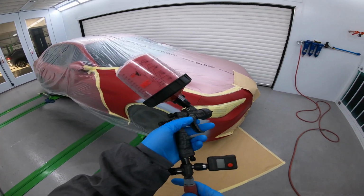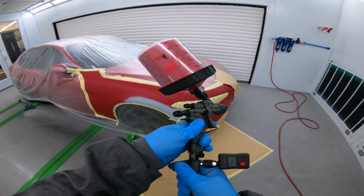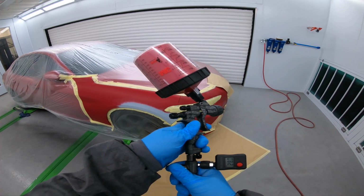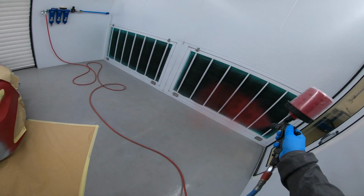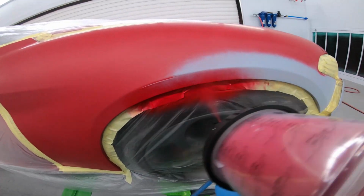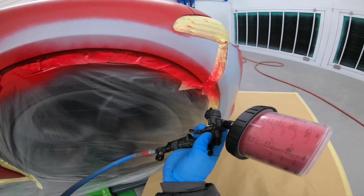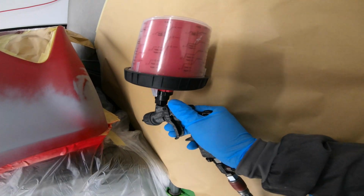Here we go, guys. Like I said in the intro, this is the motivated painters edition of the Walcom Ego HVLP. Spraying at 29 psi, and we'll get into this. It's more of a smart repair, but we've just lacquered out the whole wing just for ease. Makes life a lot easier when you can clear the whole panel rather than half a panel.